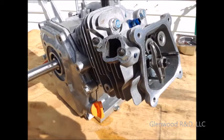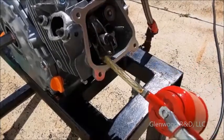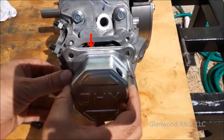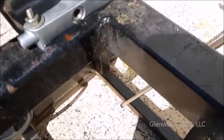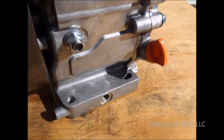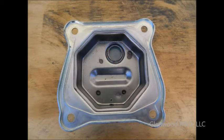Reassemble your engine. The upper valve assembly needs to be periodically oiled. You can leave your valve cover off and oil it that way, or you can locate the best position for an oil hole in the valve cover. The hole should allow the oil to land where it flows to all points, including the push rod where it will drain down to the tappet. Your crankcase needs to vent pressure and vacuum as the piston goes up and down. If you find that it is struggling to vent through the oil drain, open up other sources. You may need to remove or disable any one-way valve in the valve cover.